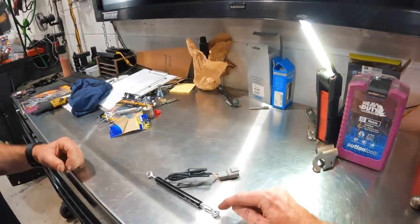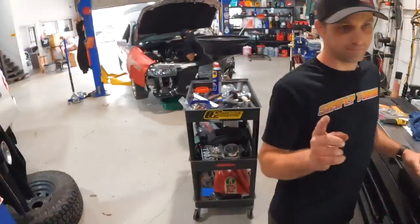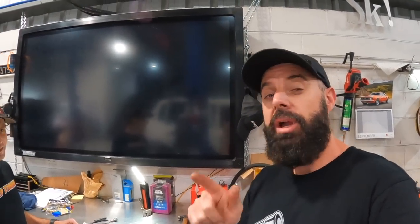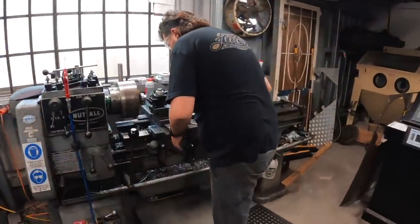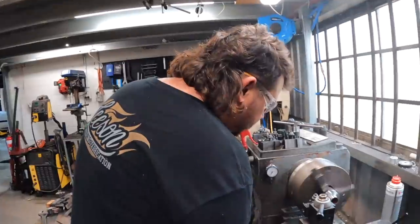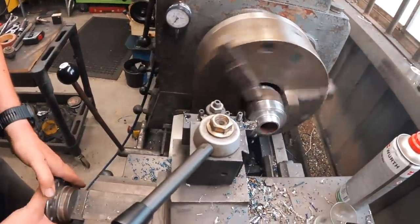The problem is the sensor has no resistance, so smashing it with your left foot at 150 km/h won't feel like a clutch. The solution: the car still has the original manual master cylinder, and we're going to connect it to a concentric slave cylinder, then join it to a spring-loaded setup that Brock is machining. The goal is to give the pedal that progressive resistance feel — hard at first, then an ease point — similar to a pressure plate's bite point feel.